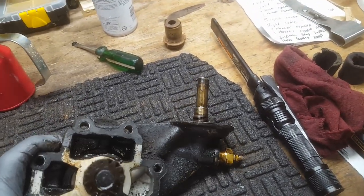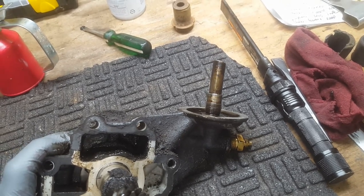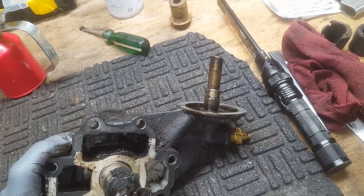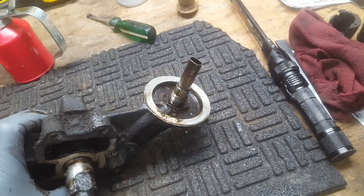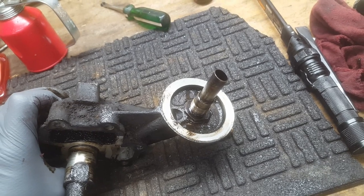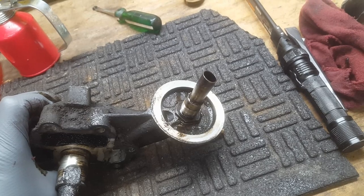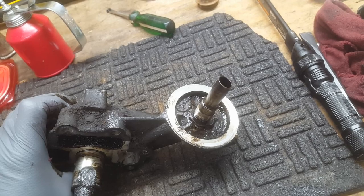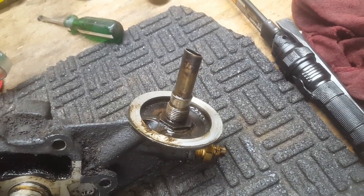And there's significant debate about which is better. I don't know why there is a debate. If you have a larger oil filter and a smaller oil filter, which would you think filters more oil? And some people say, well, I heard that the longer oil filter takes longer to turn the oil light off because it has to fill up. That's not true. I've had several of that. They turn off just as quick as any other. So that's false. And then people have said that these short standpipes don't have a drain back valve on them.